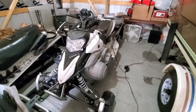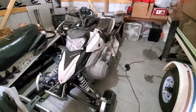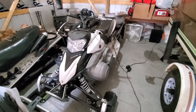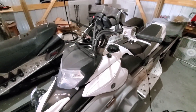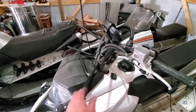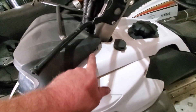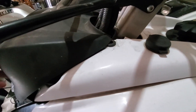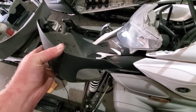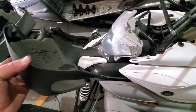I've already taken everything loose — all the bolts and everything — and figured out how to get there, so everything is just loosely sitting back together and I'm going to show how it all comes apart. To start with, I've already removed the windshield. It has four bolts, two on this side and two on the other side. Then above the headlight in the back there are two pins snapped into rubber grommets. You pop those out with a screwdriver, then the headlight lifts up and pulls back towards the rear of the sled on these notches and comes off. This is the headlight cover.